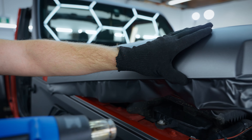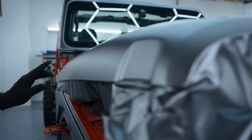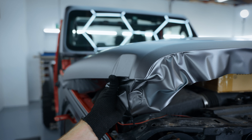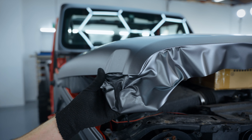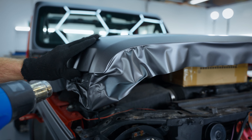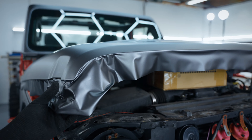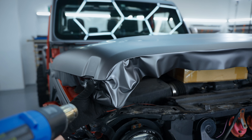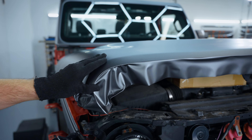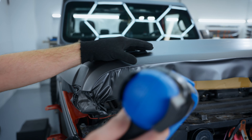Expanding with a little bit of heat at first — a little hotter the second pass, a little hotter the third pass. Right here we have to do a little bit of pulling, so I'm going to let it stick to my glove and just roll that around without pulling too hard — I don't want to over-stretch the film. Just finessing — give that some heat, a little massage, some more heat. Come around this corner — that corner looks beautiful as well. Let's come across the front ends.